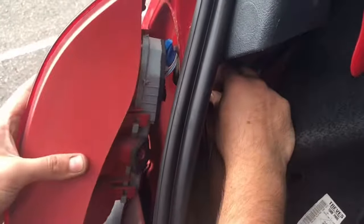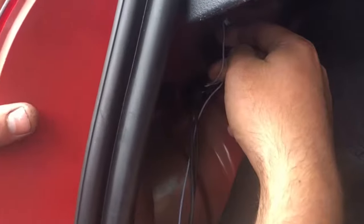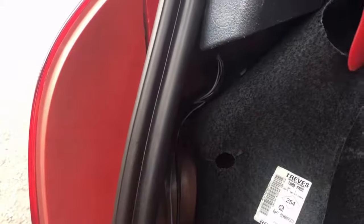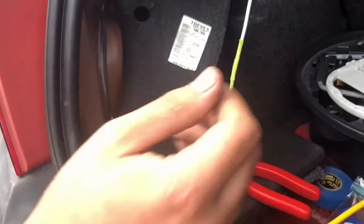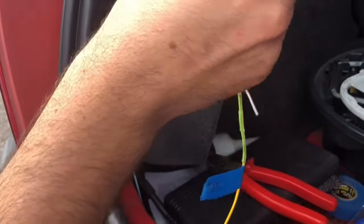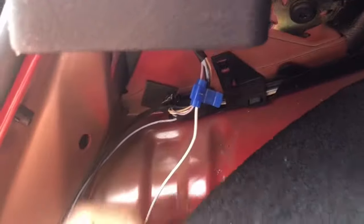So I'll put my light unit back in temporarily. We've got a crimp on there and we've already labelled it up, so that one can now be brought through. We're going to chop it to length and then scotch lock it on the outer one, and then we're going to be crimping our towbar hookup electrical supply into there. Insert it all the way - fully inserted. Squeeze that spade in, which will penetrate both wires and make a circuit.